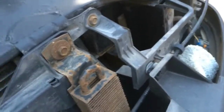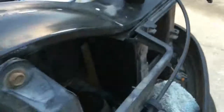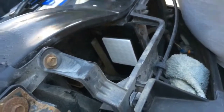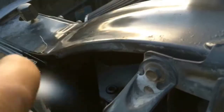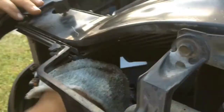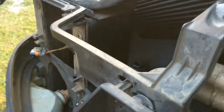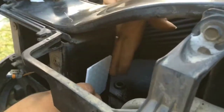first step, these are the sticky pads that come with the ballasts. I like using them as a temporary mount. Most ballasts have some way you can screw them on. That's the best way to mount them. But these stick pads are a good way to mock them in before you start. Spray everything down, carb clean, brake clean, wipe it down, and the sticker pad should affix to most anything. And that's step one. Pretty easy.